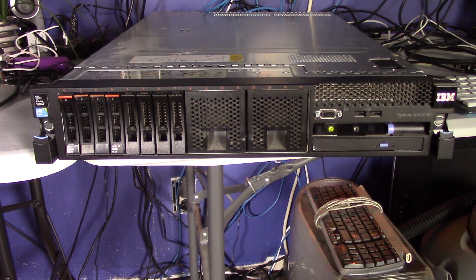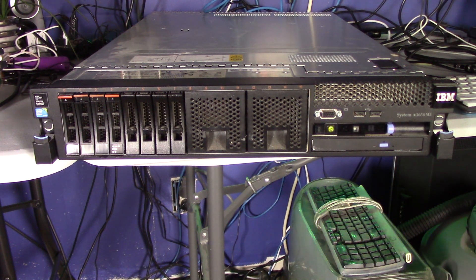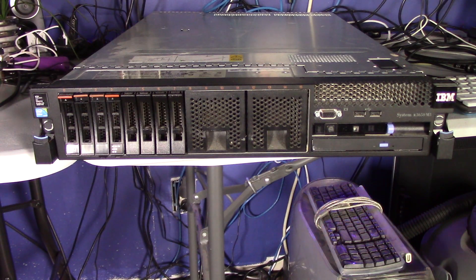Sasha Lopez over at Blue Telecoms in the UK donated a couple of one terabyte SSD drives, and I'd had them in the Synology flash station for almost six, eight months. I decided to take one out and put it in this IBM. If it worked fine, I would order another one and put it in at the customer location. But I started getting blue screens after I got Windows Server installed and started creating my virtual machines on that SSD — stability issues, running really slow. I have an IBM ServeRAID controller card in there that'll do RAID 1, RAID 5, or even RAID 0. It is a hardware controller, but I suspected there was an issue with SSDs not being supported by that controller — a SAS/SATA dual controller. I tried moving it around, tried both drives, but both were blue-screening on me.